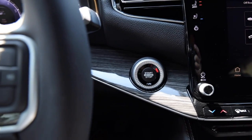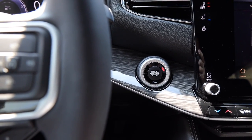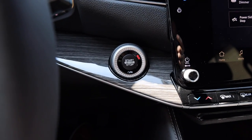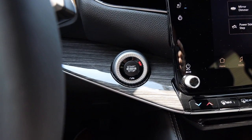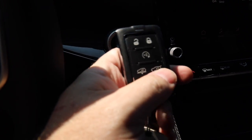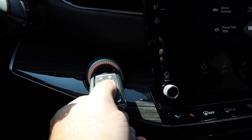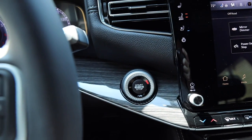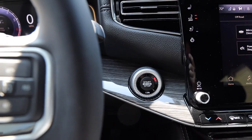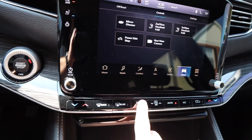Over to the start button: push it to start, push it again to stop. If your key fob battery dies — since this is a push button start — you don't need to peel off a rubber coating like some older cars. Instead, take the key fob and position the nose (where the light is up top) against the start button, then push it just as you normally would. Because of its close proximity, even with a dead battery the car will still read the chipset in the key fob and allow the vehicle to start.